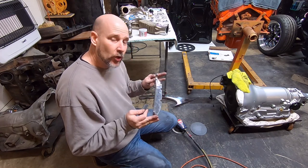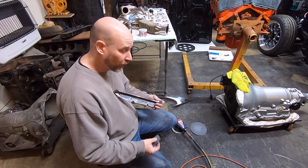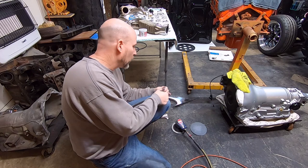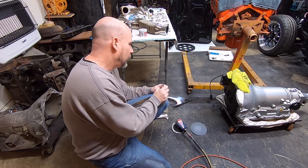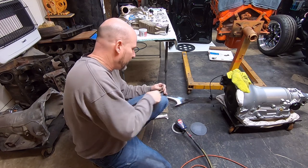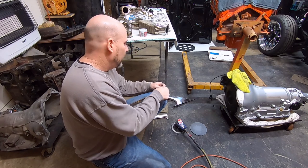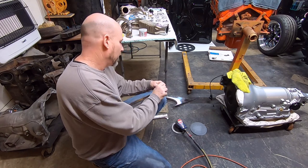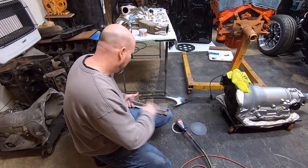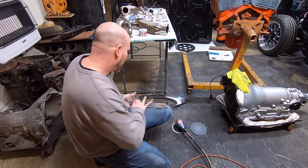The other thing about it is it will cook the rouge to the wheel. So you need to clean your wheel pretty often if you're using a standard, pretty high RPM bench grinder, which is what I'm using. I do have my eye on one at Harbor Freight. I saw it about a year ago, and they advertise it as for polishing, and you put your cotton or muslin buffs on there or whatever. I haven't had the money to spend on the buffer, because I can get what I'm using to work.